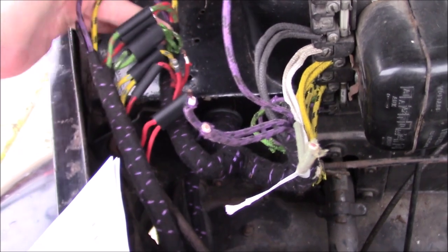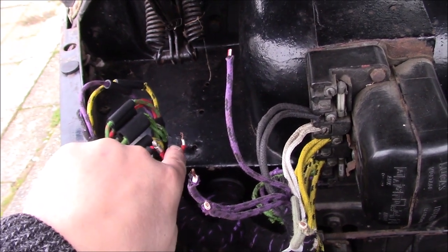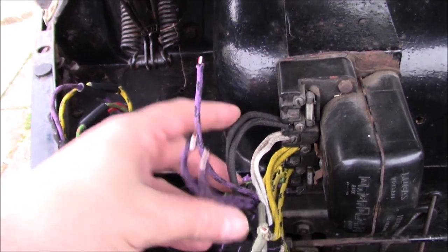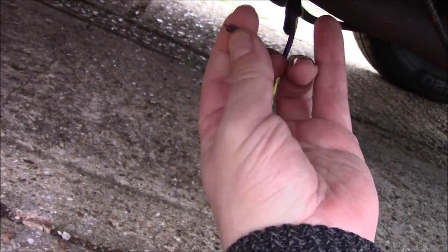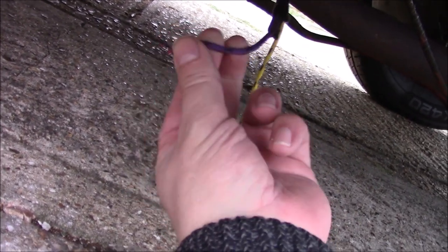It's another day and I went out and got some more of these connectors, so I now have the full complement of connectors, which is great. I'm waiting on a bullet connector arriving so I can reconnect that. I've worked out some of these wires — this one here with the red trace actually goes to the brake switch. This purple wire has a red trace on the inner wire, and looking at the wiring diagram I know where that one goes.